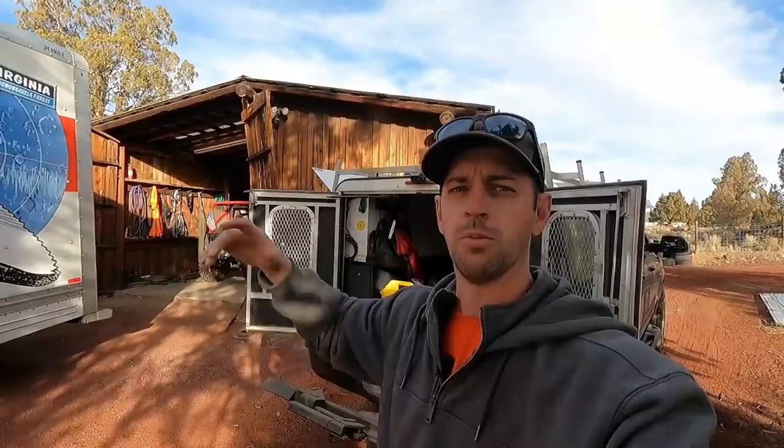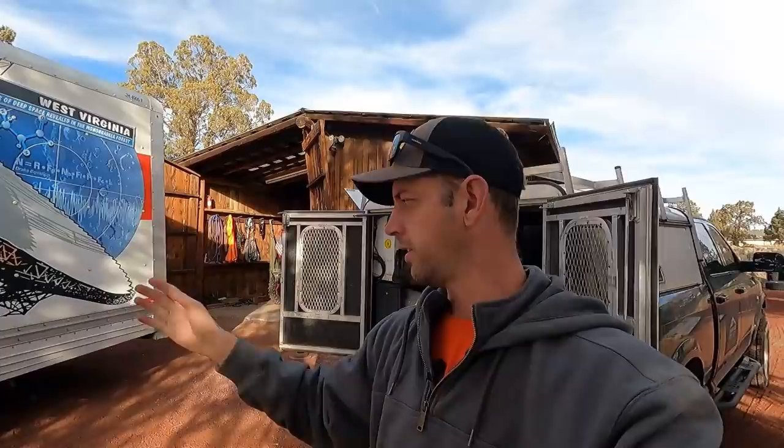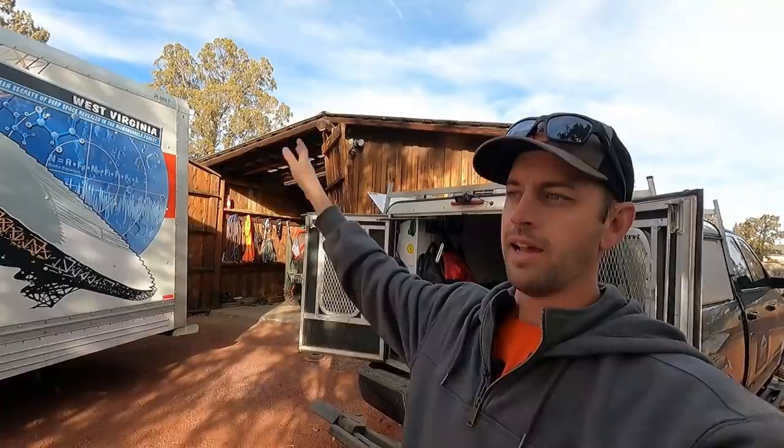We made it back here to my shop. I got the Jeep unhooked off the back, and as you can see, the truck doesn't fit in the shop. The reason I went through all the effort of bringing the truck here to still work on it in the dirt is because I'm not 100% sure what caused the wheel seal to fail. This truck only has 62,000 miles on it — that should not have failed. So is it a faulty wheel seal, or is it a bearing going out, letting the axle move up and down? Or is that axle twisted, not totally straight, and as it spins, also going up and down, wiping out the wheel seal?